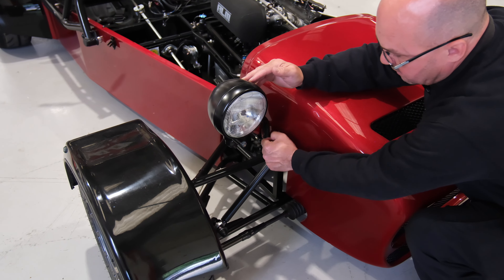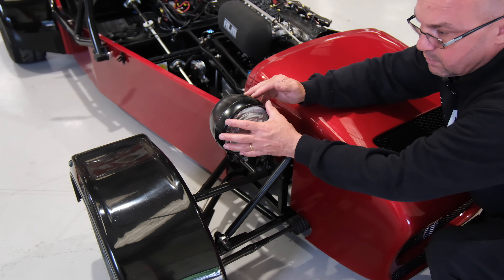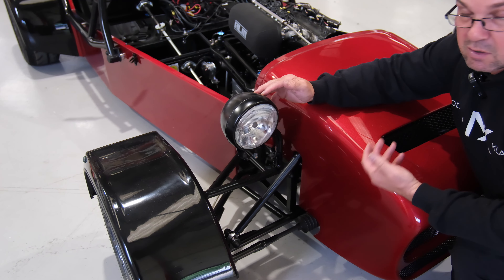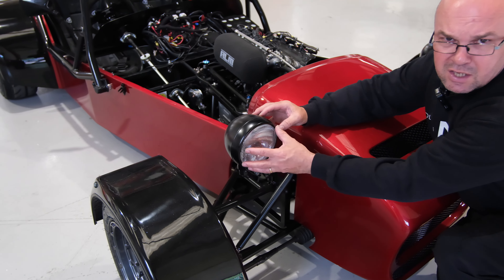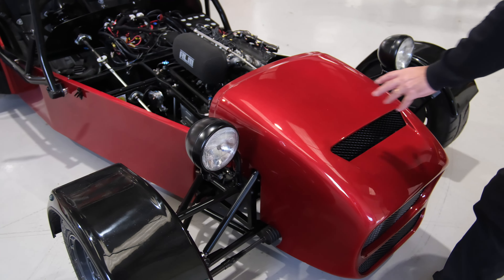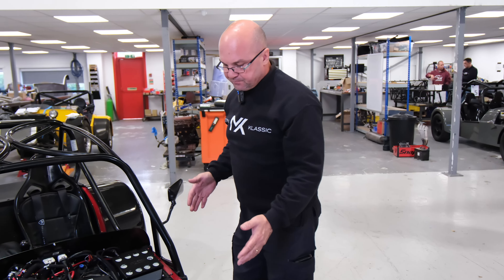The headlights have to be at the 400mm height for our brackets. These bolt off, so if you go racing or on a track day, undo this bolt here, one little plug, and the headlight comes off. Indicators are already built in, all in one unit. You can remove those for your track day, or like this car which is a road-legal race car, you can take them off for the event to prevent damage and improve aero efficiency.